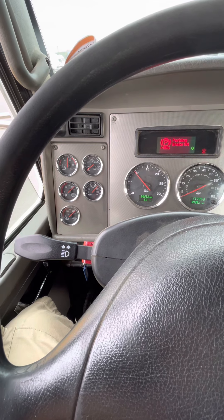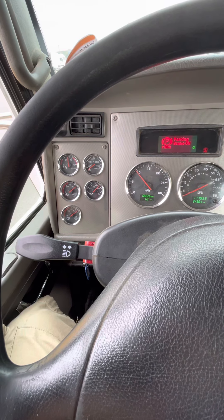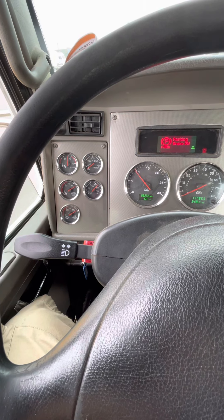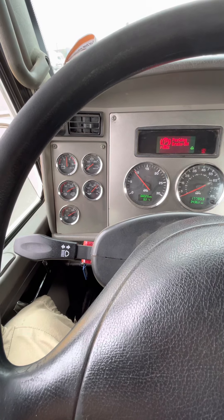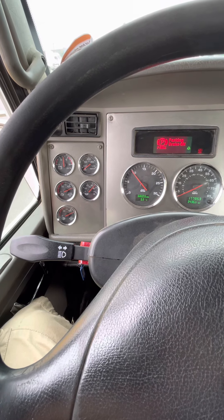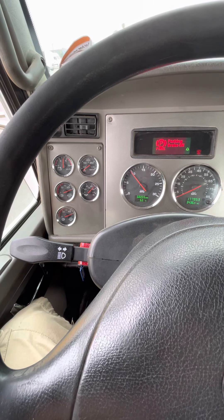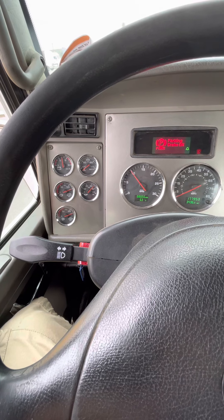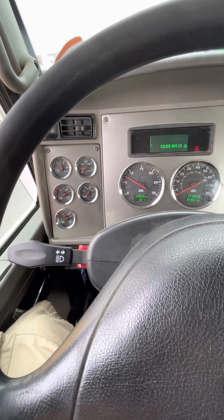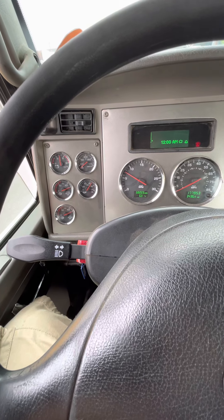It's going to cut out at about 125 to 130 — each truck is different. My needle stopped rising at 125, showing my tanks are full. Now I'm going to begin my applied pressure leakage test.